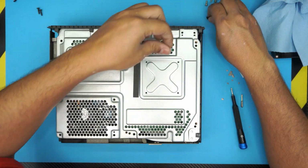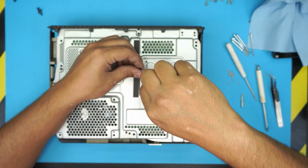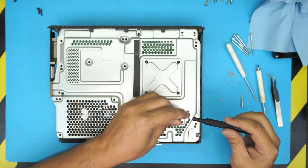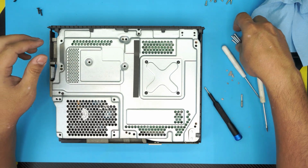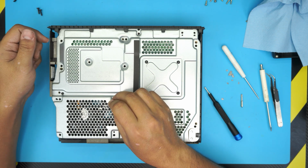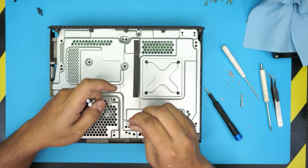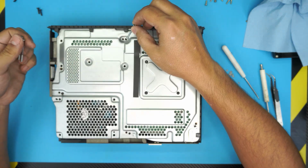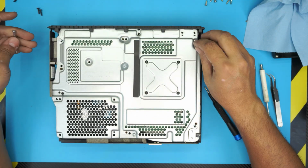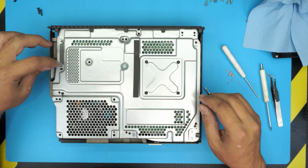First, we put the 4 screws for the X clamp. Alright. Now, the long screws, it's very obvious where it's supposed to go. It shouldn't go where you can see the plastic. It goes on the empty spots, which look very deep. So, like in the middle, in the corners, and this one's supposed to go right there.